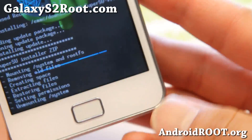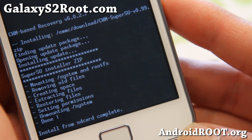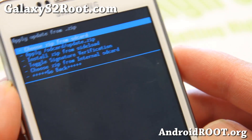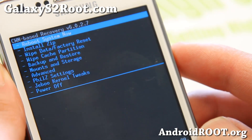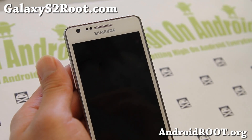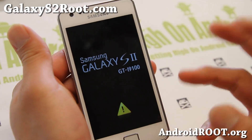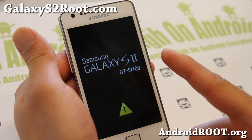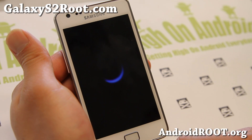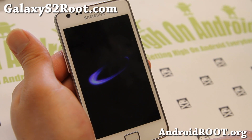Say yes and this will install all the files — it takes about two seconds. All done. Go ahead and reboot and your phone is rooted. You should have a fully rooted phone. You can use this method with any Custom Recovery to flash that file on any Android device — most smartphones — and it will root your Android smartphone.